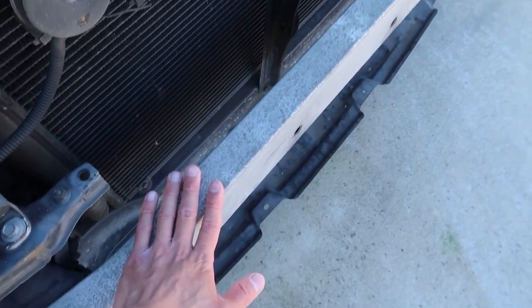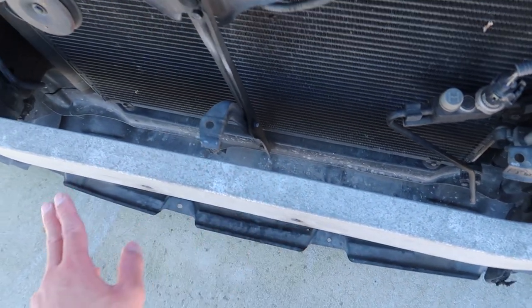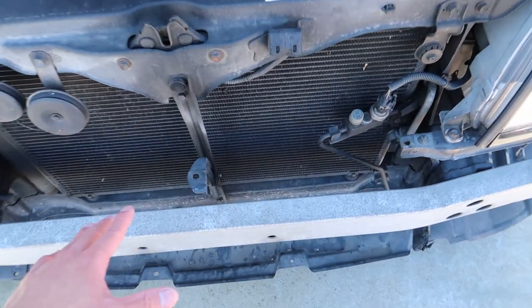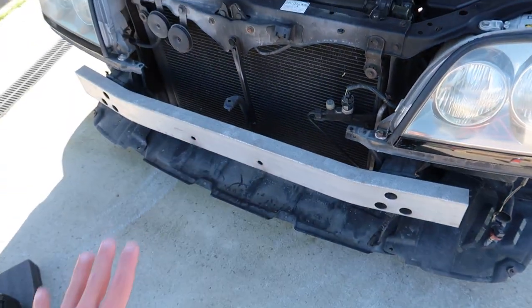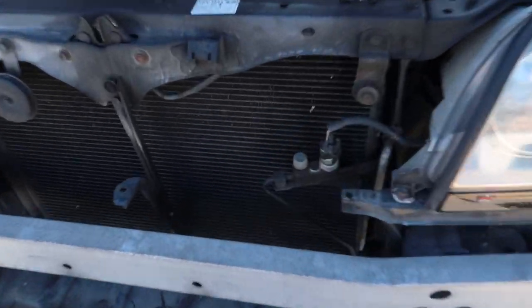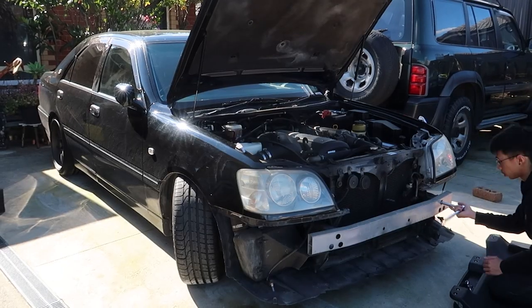What I realized when trying to install this front-mount intercooler is that it doesn't fit with the crash bar. I did a bit of research on the forums and Facebook pages and there are two methods: one is to remove the crash bar or modify it by cutting a slit so the front-mount can fit, or the second option is to carefully bend the AC line so there's enough room and you can still keep the crash bar. I'm going to go with option two because I'd rather not have AC but keep the crash bar. Hopefully we can slightly bend it without breaking it.